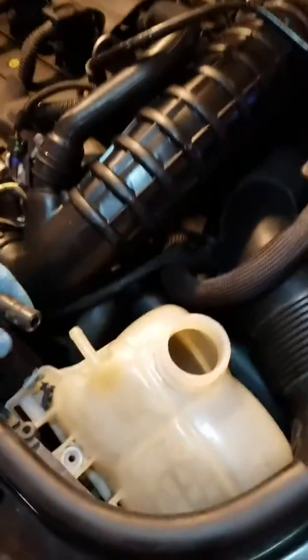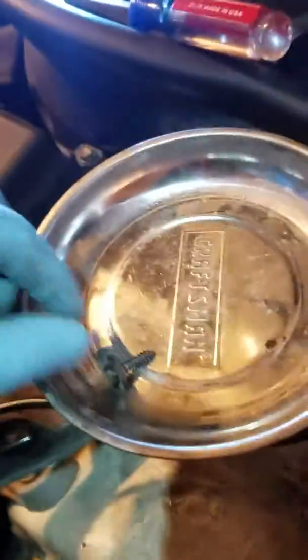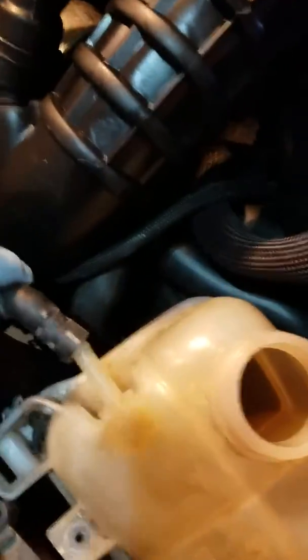So first, drain the coolant from the hose up underneath here, dripping down, and then I'm going to disconnect the reservoir, just to get some room in here to work. I like as much room as I can get. So I took off an 8mm screw so far, just a little bitty one there, that mounts to the reservoir, and then the overfill tube. On the bottom of the reservoir, there's a little clip you pull out and then it'll just pop out with probably an O-ring. So we're going to do that right now.